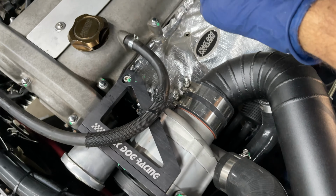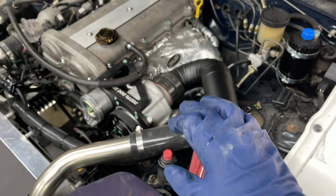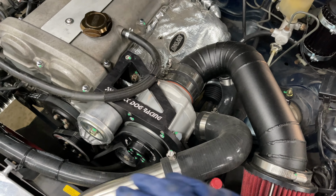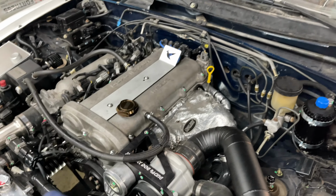What we're gonna do is we're gonna change out the oil. I kind of went ahead and double checked everything. I got all my stuff retorqued that was important to me. Anything that I visually wanted to look at real quickly, that's what all this little green marking is everywhere. It's just a visual aid to see if the bolt has moved without actually going there and testing every single thing. That kind of lets you know real quick that something has moved.